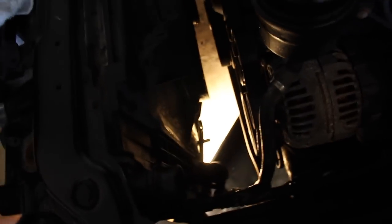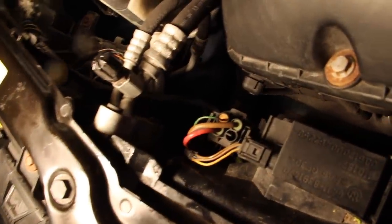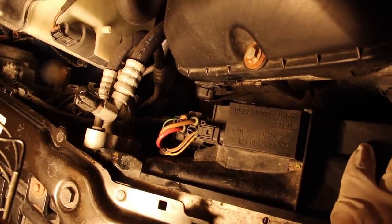Now we can move on to draining the radiator. Kenan pulled out the little blue drain plug for the radiator. There's a lower hose — same thing: pull up on the clip, pull the hose out. There's also a sensor there which we may or may not remove. Because of the positioning in the car due to gravity, this is where a lot of coolant flows, so there should be several cups sitting in that hose. Definitely have something under there ready to catch the coolant when you disconnect it.